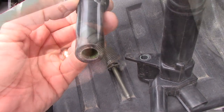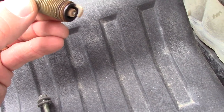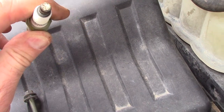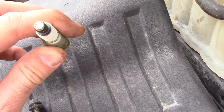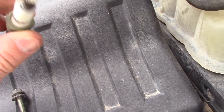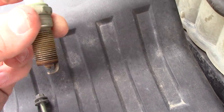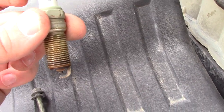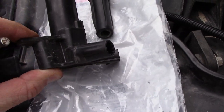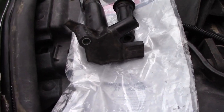I'm going to pull this plug also and take a look at it. Again it looks pretty normal for the age — about 50,000 miles. The top of the plugs have this painted white coating, and I'm not sure why that's on there. It can't be good for the resistance, but maybe it's supposed to be there. I'm going to clean this up and see if I can fix this one with the boot kit I had for the other one. I'll give it a shot before I have to order another $80 coil and wait for it to come in.